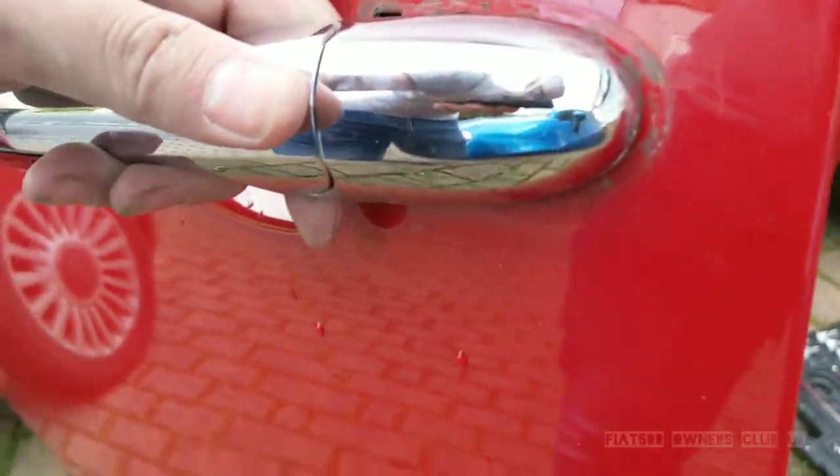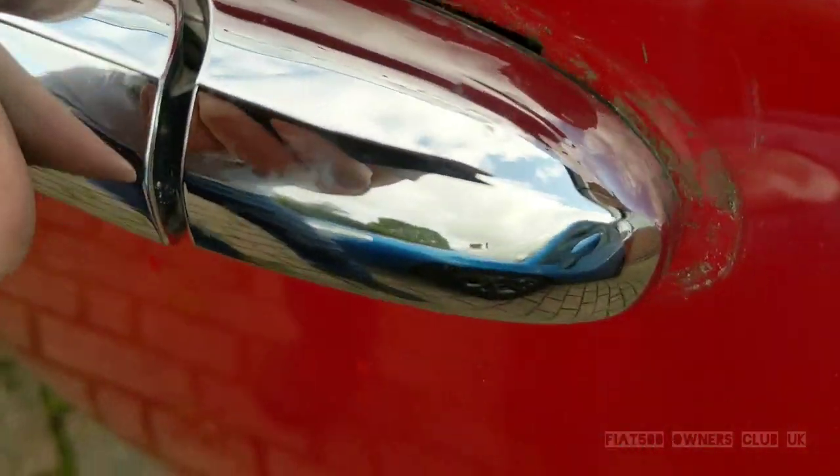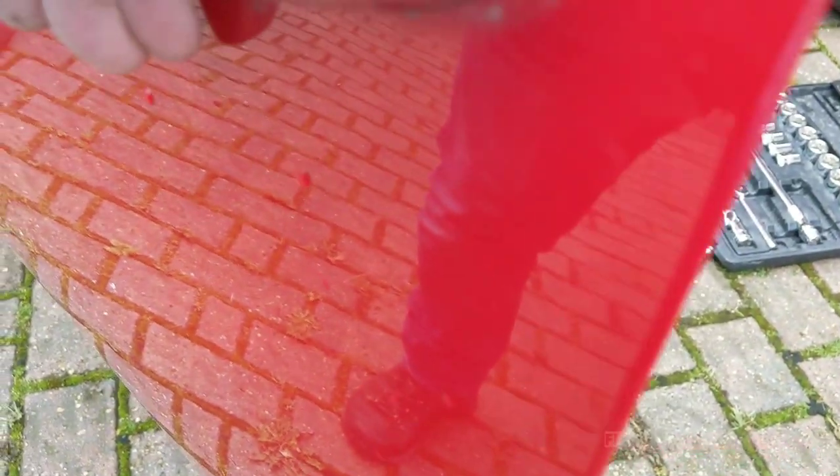There, just to show — the bit at the top is the back of the door handle, and the rod is connected to the latch mechanism just below it. We'll need to remove this rod, which simply presses out. Then pulling the front part of the handle first, we can remove the door handle — it just takes a little bit of jiggling to get it to release from the door.